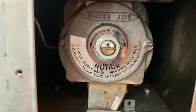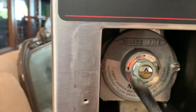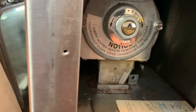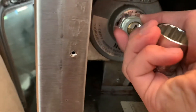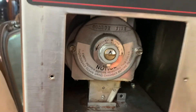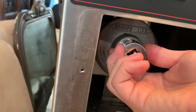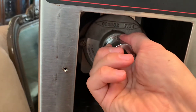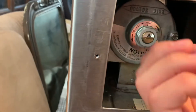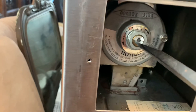So the question is, how do we adjust grind size — how do we adjust coarseness? At first I tried to go in there with a screwdriver and just give this a turn. But that's not going to work, because you actually need to loosen the nut that is around the coarseness adjusting screw. So I went and got a socket, slipped it over — luckily it's not super tight — gave it a good squeeze and a turn, loosening it about a half turn or a full turn. Then you can adjust the coarseness adjusting screw.